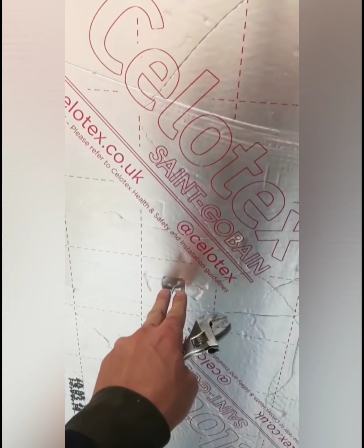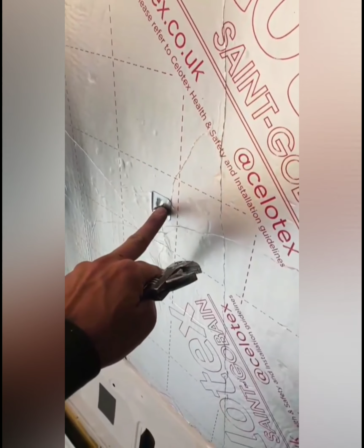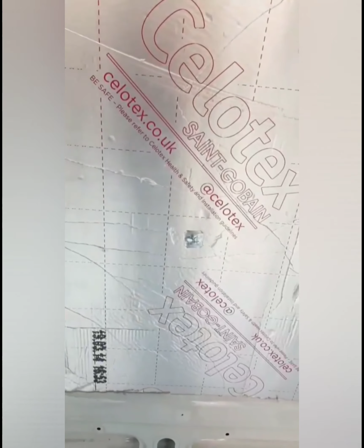It's taken about an hour to do one. So the stick pins actually didn't come through, so we had to put 2 on the little risen area here. So there's 4 that are sticking it into place, and then 2 on the risen area. And after that, the pin comes through, and then you just bend off the pin and then place a little bit of aluminium tape to seal it off.